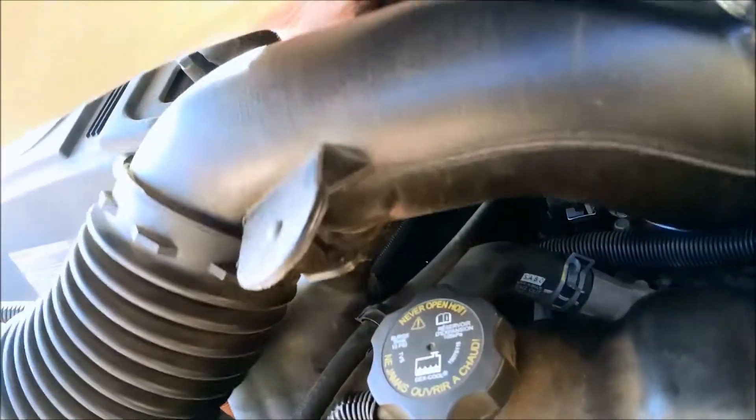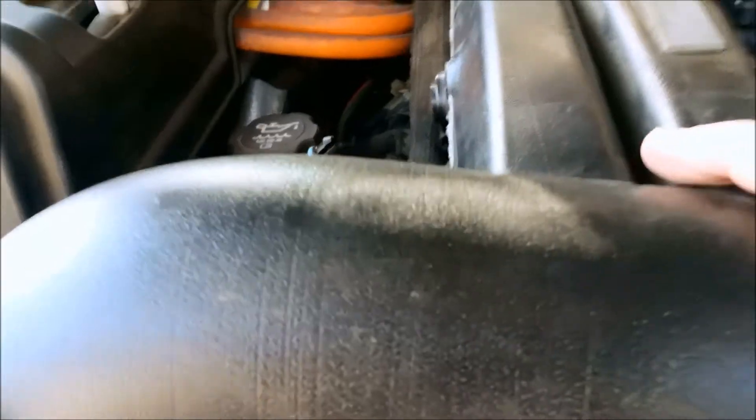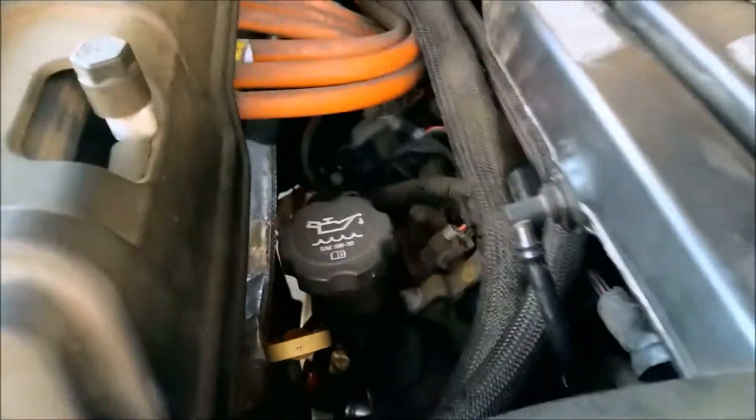The hard part is getting this back on — sometimes it doesn't like to go into its place. See how it's tilted slightly up. Push in, push down, right into place — see, it goes right into place. Then you reconnect that back, reconnect your power. Also don't forget to reconnect that vacuum line right there.